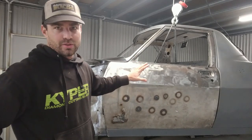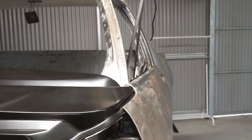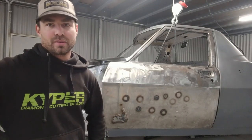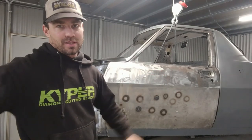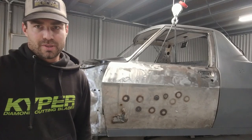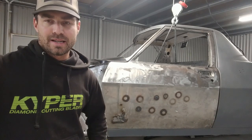I've hung the first door on the passenger side using the little winch I've installed in the roof. The panel gaps are pretty good — I'm happy with the plenum based on that door. As I said before, if you stick to the old template it's bound to be alright because this plenum mould is pretty much spot on. I'm very confident the other side's going to be alright but I'll hang that door anyway, check both, and also just hold a guard up to check clearance.